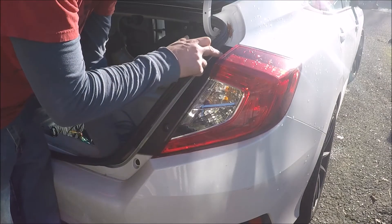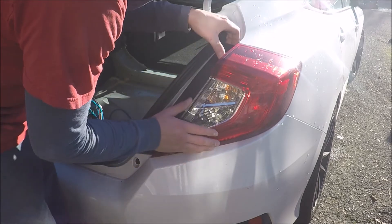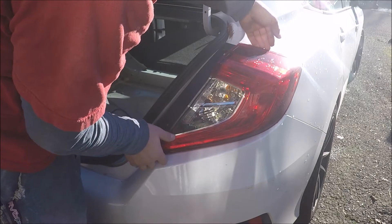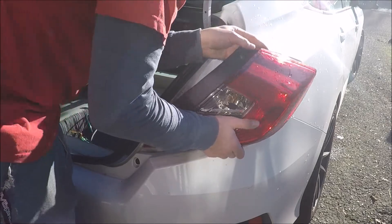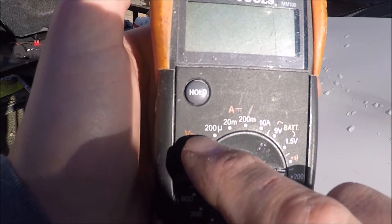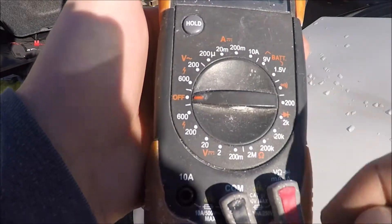On the Civic, after you take these two screws out, there's one clip right here that pops out, and it looks like there's another one there as well. So you can see those two gray holes and those two white little nipples — popping those out. The squiggly line on the multimeter symbol is AC, and down here on my finger — right there — that's DC, which is what we're looking for: 12 volts. Set the multimeter to 20, the closest range above what you're shooting for.